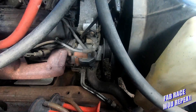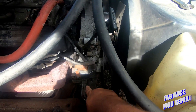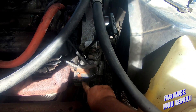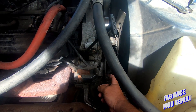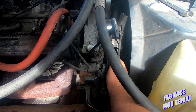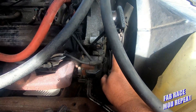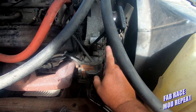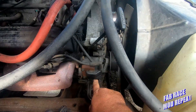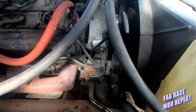So I'm going to replace that too. About a day to get back out here with things going on. What I got to do now is take the coil pack out of the way — that'll let me get to this big bolt back here. There's a 15 millimeter nut on the back of the stud that holds this idler tension pulley on, and we can get it off. Put a new one in, put the coil pack back, and then we'll get the alternator back on.